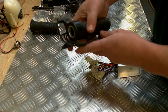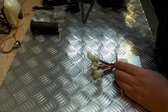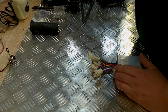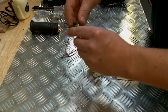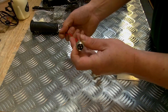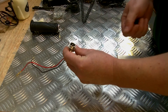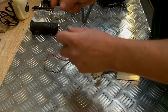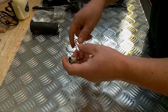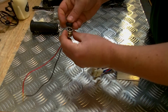Although if you use pedal assistance as well, your battery will last substantially longer because you're not using as much power. You also get a charger — if you have a 24 volt charger you could use this straight on the bike to charge both batteries at once. If you don't, it's just a case of using a standard 12 volt car charger and separating the batteries, charging them one at a time. It does come with this charging unit.